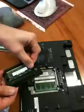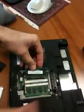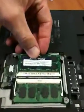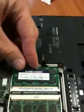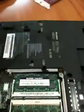There should be a little finger hole right there. Do your best not to touch the gold connectors. It goes in at an angle — maybe like a 25 degree angle — slides in like that. You push it down and it should snap in nice and tight. Don't force it.